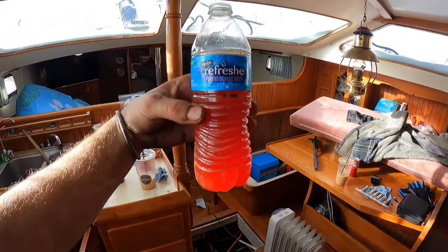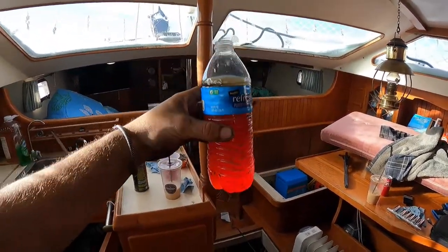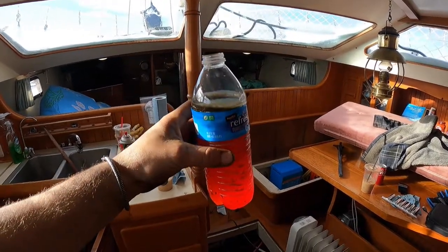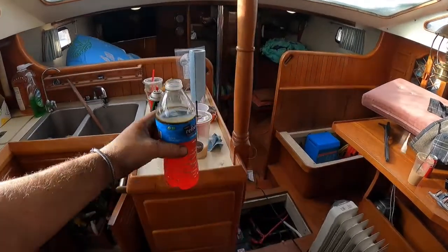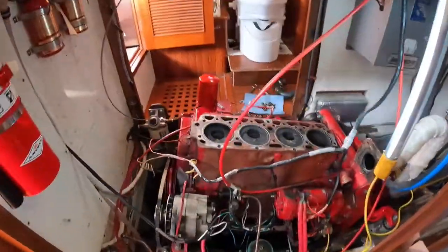What came out of the bottom of my oil pan — I use red coolant, obviously — that is pure coolant, still getting into the oil pan. What that means is your coolant and oil mixing generally means head gasket. But it's running so good.